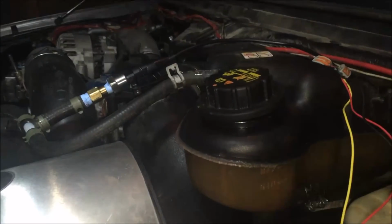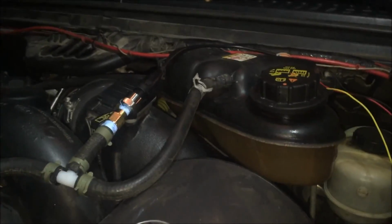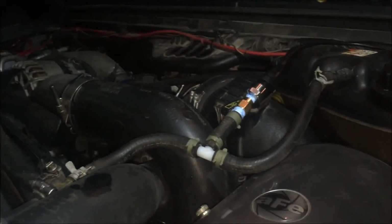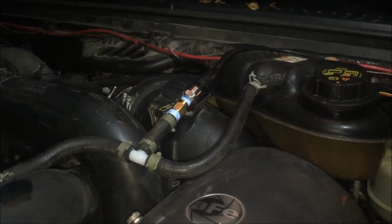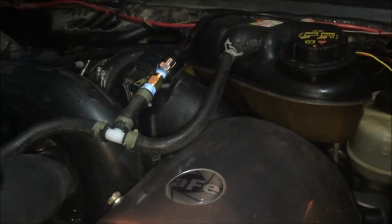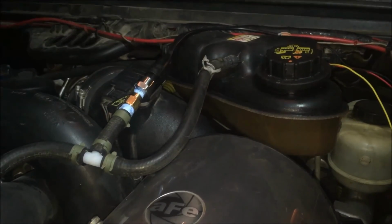If for some reason you keep going above 15 and blowing out coolant, you need to look at your head studs or your head gaskets issue, or if you still have an EGR system, that might be failing too, all caused by maybe an oil cooler going bad. So follow forums. There's a lot of good information on that. Feel free to ask me questions in the comments about trying to diagnose why your coolant system pressure is high, and I can kind of help you with that.